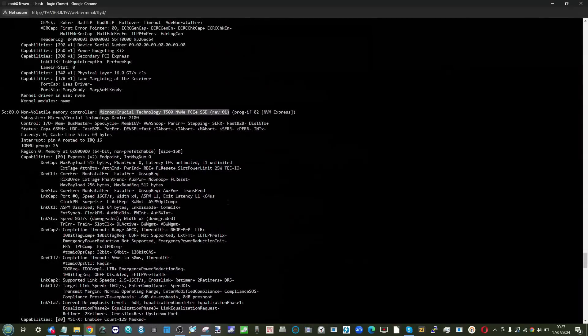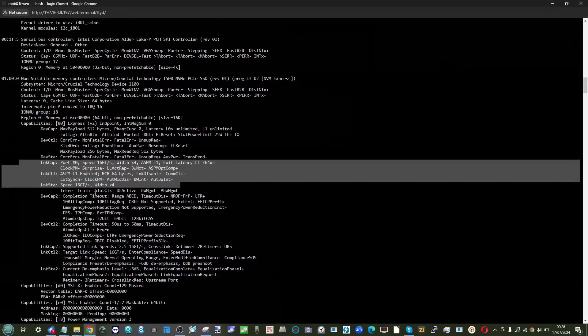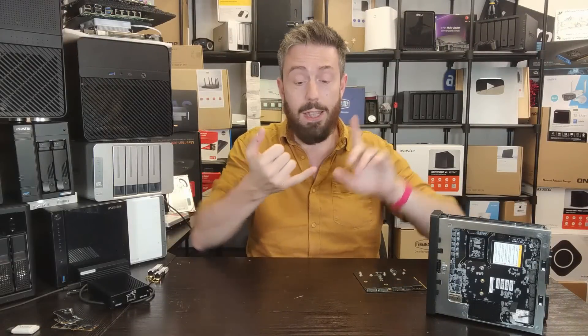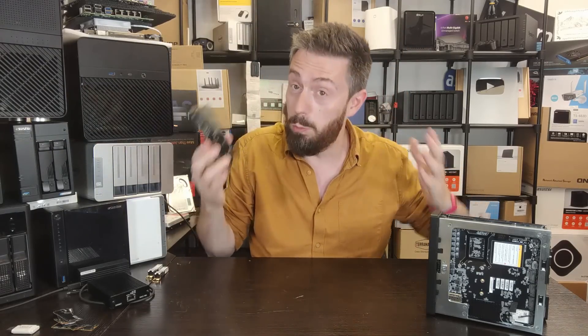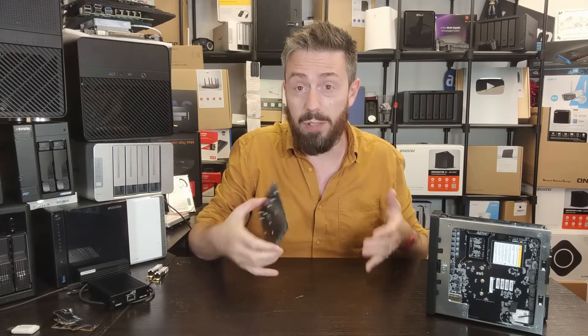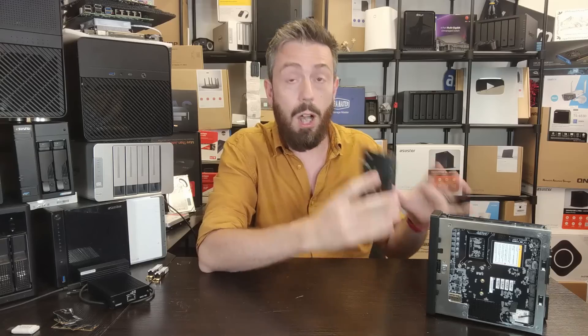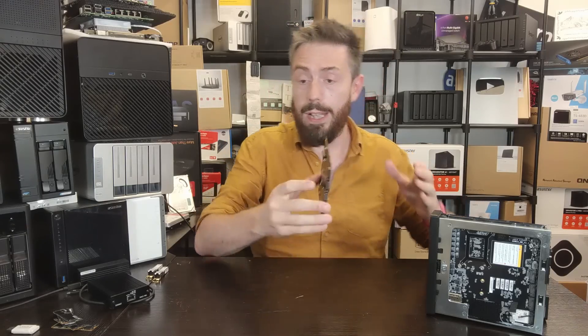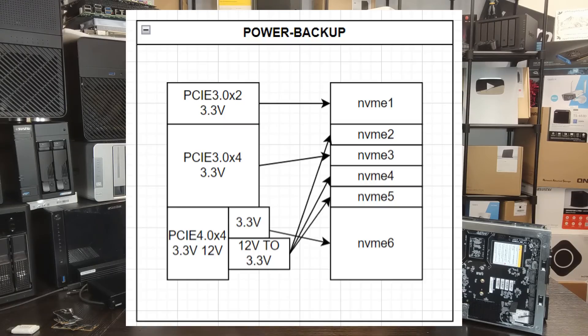When we looked at lanes internally, the distribution they told me about pretty much evened out. Going into UnRAID terminal, we saw all individual lane distributions for each drive matching what they indicated. The buffer and distribution is important here — this card is split across three M.2 slots, not a single PCIe slot with a card, which makes it a messy arrangement but necessary given the MS01's original hardware configuration. Slots one through five share the buffer in/out distribution, with the last 4x4 slot going straight through to the existing U.2 pathway. The power distribution diagram they provided is frankly crazy.